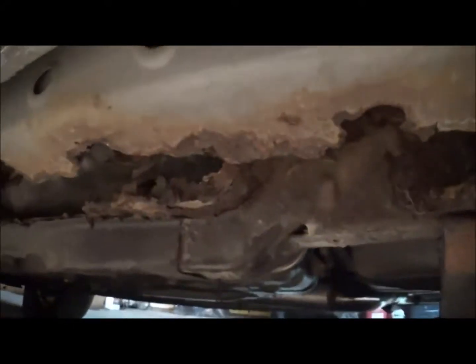I got my little section cut out here — you can see how crappy it is. I'm gonna do this relatively quick, but this piece will have the one-inch seam that's supposed to be on it. I'll have to weld up some of the back section to bring it down, and then I will weld in this section. What I did was I cut it relatively straight right along here, and I already had my other piece pre-shaped to the general shape I wanted.